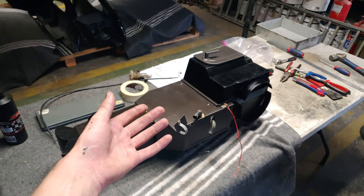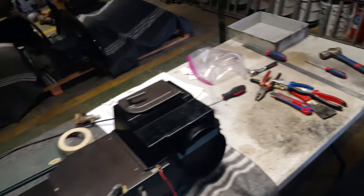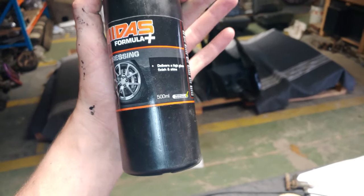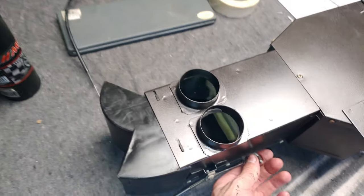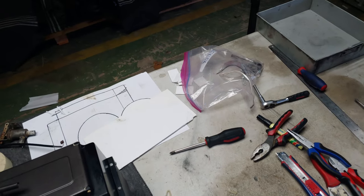The powder coating type of paint they used on the interior was still in good condition, so I just washed everything out with soapy water before putting it back together. To get the plastics nice and black again I just washed them and rubbed in some tire dressing — it gives them that good old look again, fresh out of the factory. I also replaced the foam on the little flap, the foam around the heater, and the little cardboard piece. For the cardboard I used a stiff styrofoam you can get at stationary stores.